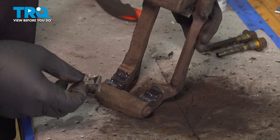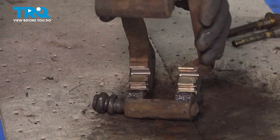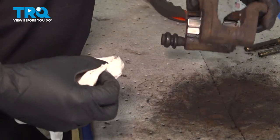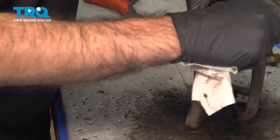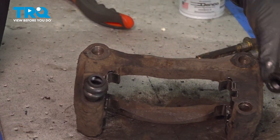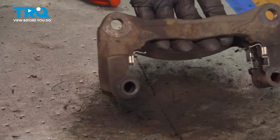Do the same thing on the top or the other side. Once you have your hardware in place, what I like to do is take a rag, ball it up a little bit, and come back in the center where your brake pads and rotor will be, and just clean that of any grease that might have gotten squished out. That'll stop that grease from transferring onto your rotor when we install the bracket. So as far as the bracket, we're done. We still have a small issue with our boot, but this boot is wrong for this vehicle, so we'll deal with that when we get to the vehicle. Our caliper bracket is done — we can set this aside.